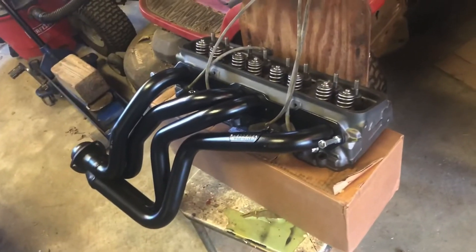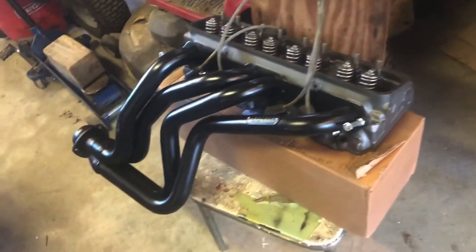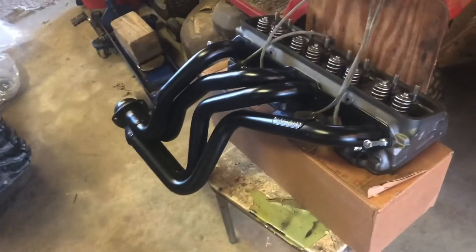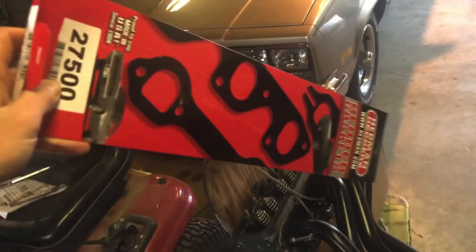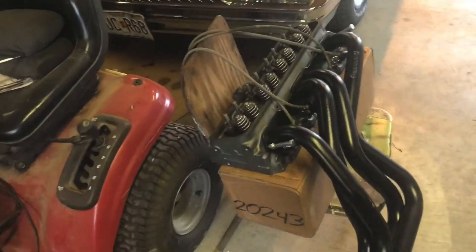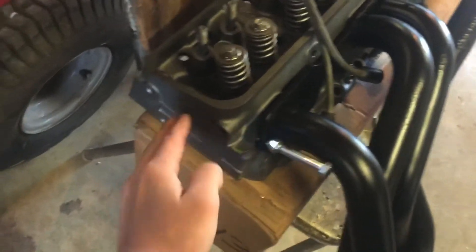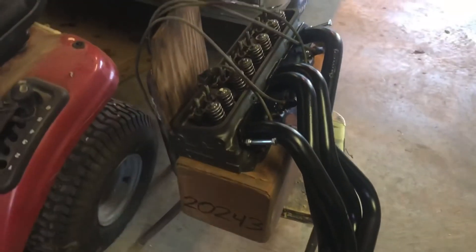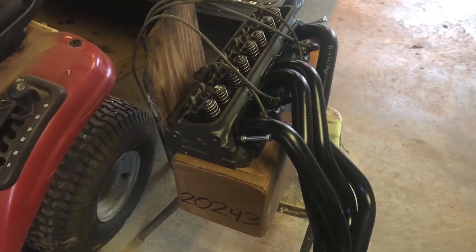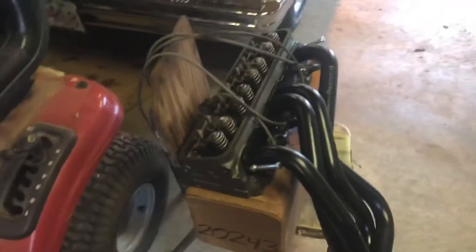These heads never came in a Camaro, but it's still a small block Chevy, which did come in Camaros — it kind of surprised me. Another thing that occurred to me is that I haven't even put the gaskets on yet. In theory, when I put the gaskets on, that will increase the space between the head and the headers — kick it out just a millimeter or three — and in theory increase my clearance. So bingo, we're off to the races.